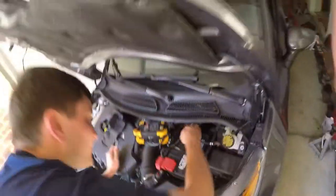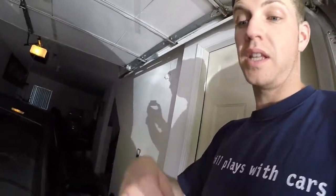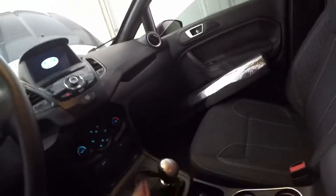All right, and mind you, you pop that clip out with the gear selector in neutral. Reminder: before you pop that clip, make sure it's in neutral. Now that the clip's popped, you're going to go in there and put it in fourth. And then you're going to pop the clip back in. Getting in here, put it in fourth, and get back over here.